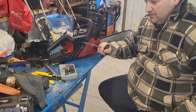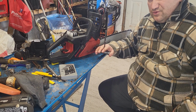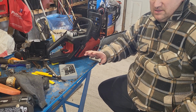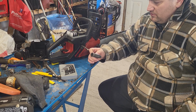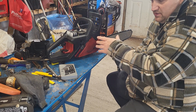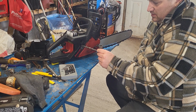They're both very important. Basically what you want to do, to get this thing running, is 1.5 to 2 turns on each one, 1.25 maybe. But you set them both at 1.5, they should start. Just start there and see if it idles. If it doesn't idle and dies on you, what you can do is turn that throttle screw in a bit and then take your low speed, and you want to go counterclockwise because you're taking them out. By taking them out, you're letting more fuel in. So you want to go back and forth between your low and your throttle.